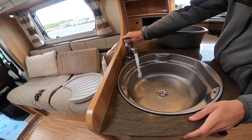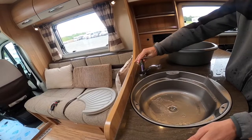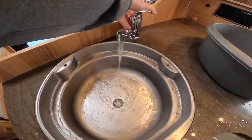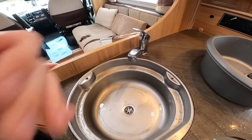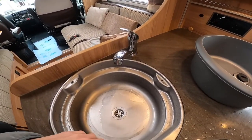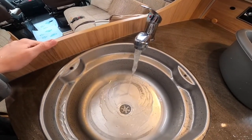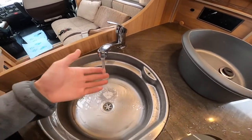As long as your pump's on, it's purging the water through there. This is what will happen if you've drained your boiler off and you're putting the water back in — just let it do its thing. As you turn to the hot side it'll start to cough and spurt, and you'll hear the water until you get a free flow — this is when you know your boiler is full. After the winter, once you've drained it down and want to use it again, it just takes a few minutes for the water system to get pressurised.